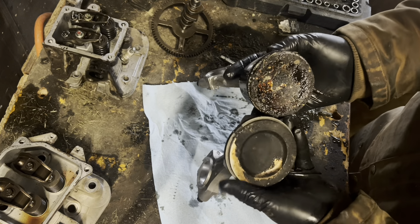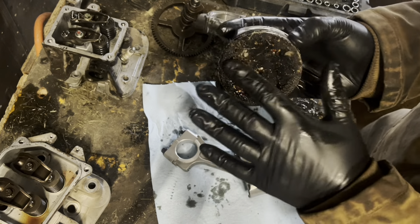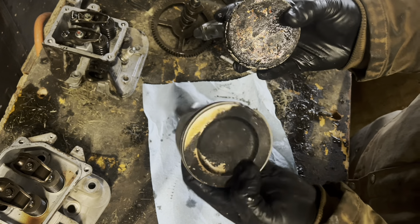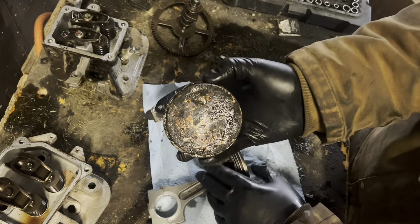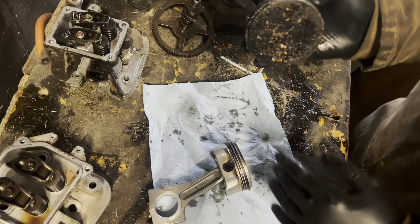You can see the Kohler is dished, and the Briggs is also dished, but dished a lot less than the Kohler. You could make the argument that less dish gives you more compression, a little more pop out of it — true, but it's so subtle.